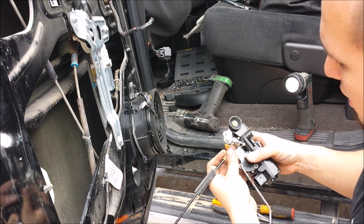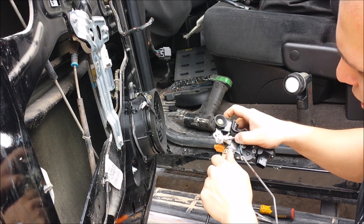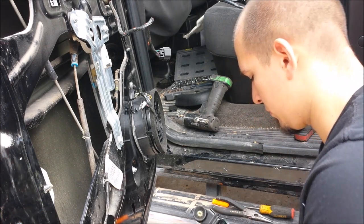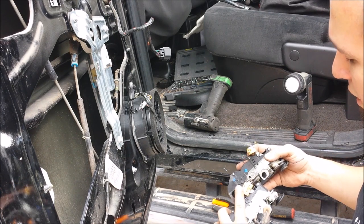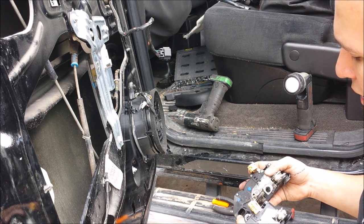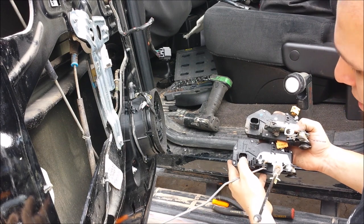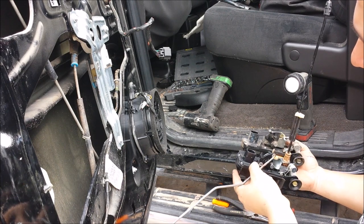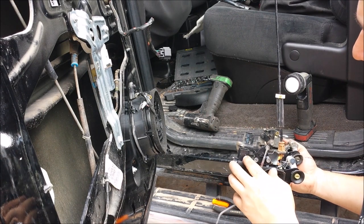Get your new one and slide it up in there. You might have to pry up on this a little bit to get it under there, and then you snap this one and just push it in. You do not have to transfer this plastic over — that one has already got it so you can utilize this one. It works the same — they rotate, just in case you are worried that yours is sideways. Make sure you have the same amount of prongs inside of the connector and that the connector looks physically the same, so your plug over there can slide on successfully.